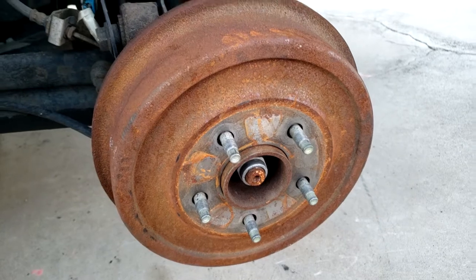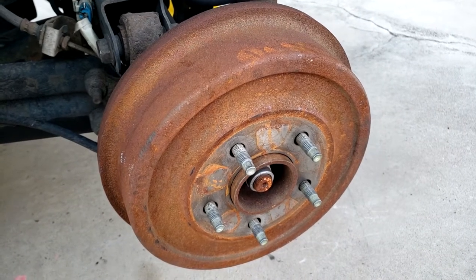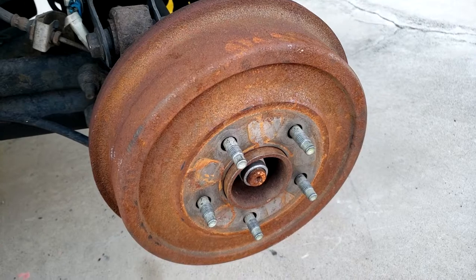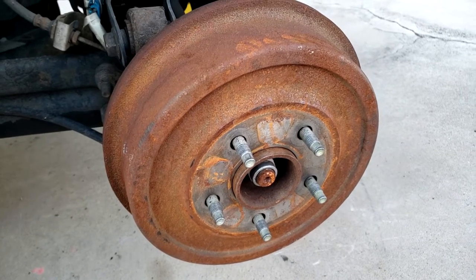Another reason is to check for shoe wear. You can't really have a visual sign like caliper brakes where you can look at the pads and see how much has been used — especially if you buy a used car. The only really telltale sign is noise or squealing, and that's usually when things have gone too far, so it's a good idea just to have a look.